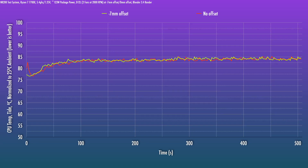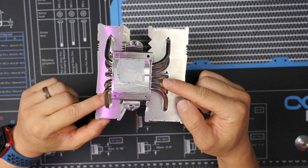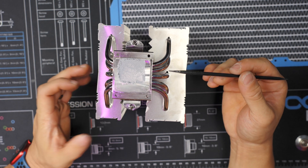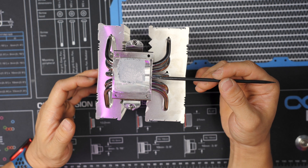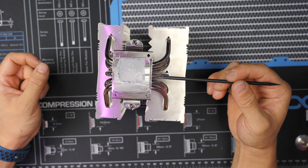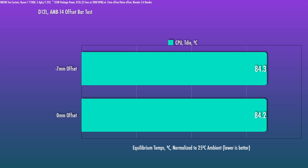With the D12L and AMB14, there was interestingly no difference. With dual-tower coolers it often comes down to heat pipe placement. I intentionally left the paste on the base plate so you could see what happened — the cooler shifts down, so the contact patch moves up and perhaps better aligns with the CCD via the middle heat pipe. But the IHS is now no longer in contact with the last heat pipe on the other end, so it's a wash. Six of one, half a dozen of the other — no difference whatsoever.